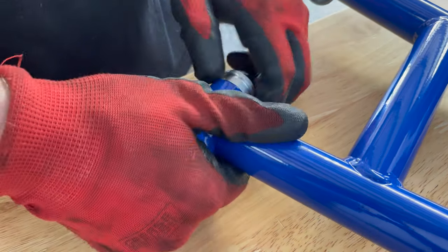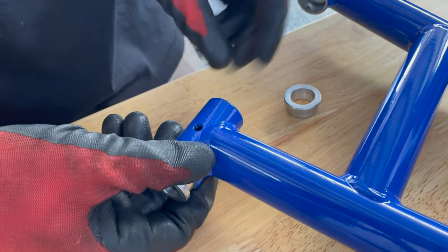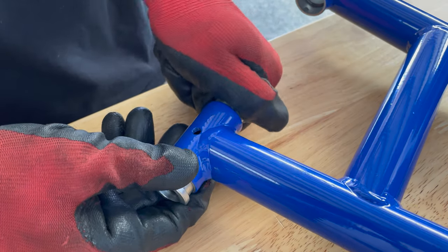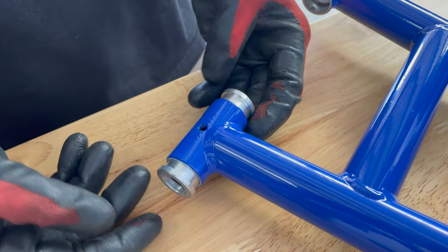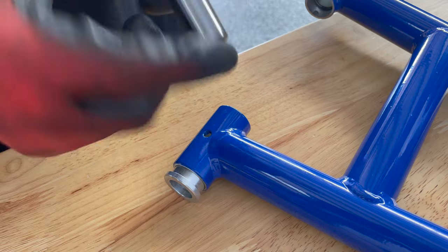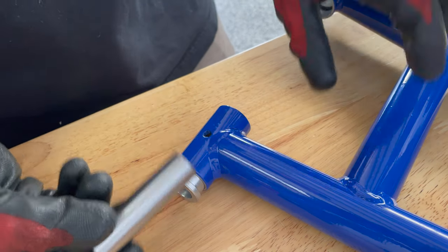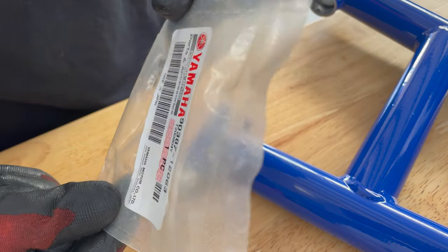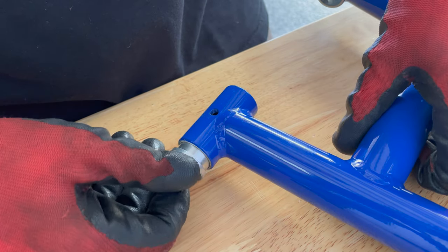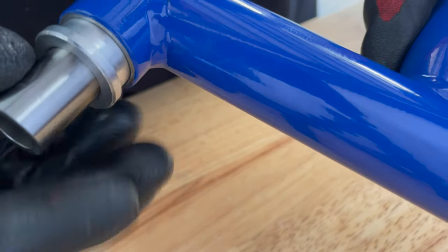I considered the titanium kit on my first car, but at that time it would take several weeks to get made, whereas the chromoly kits were in stock. So I just didn't do it. Now I'm putting these bushings in. This is a factory collar — I use it to line up the bushing correctly before I take it to the press. The front eight are all the same size: two in each upper and each lower A-arm.